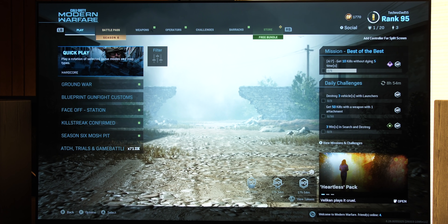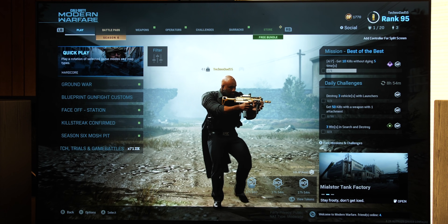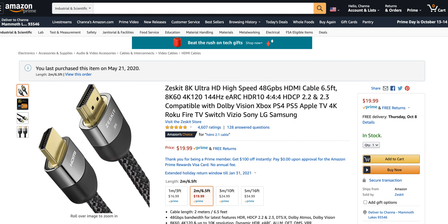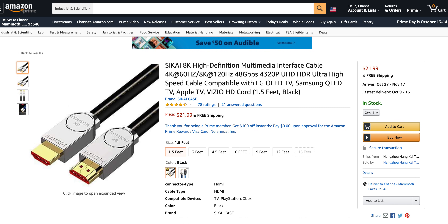I went ahead and plugged in my Xbox One X to the 8K port. If we go and check out the info pages on the Marantz, we have a 4K source coming in that has VRR — variable refresh rate — so that is detected. And you can also see ALLM up in the corner, meaning auto low latency mode is on and active. So the SR7015 passes everything we need at this point. I'm pretty sure the PS5 and Xbox Series X will come with their own 8K cable, but you will need another 8K cable to go from the AVR to the TV. I have linked up a couple in the description. You want to make sure whatever 8K cable you get has Ethernet, because that Ethernet is what's going to make eARC possible. So check out the link in the description for my recommended HDMI 2.1 cables.